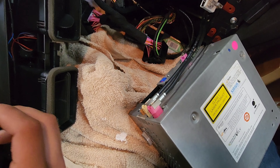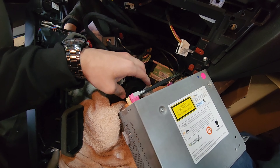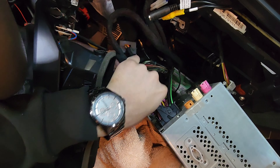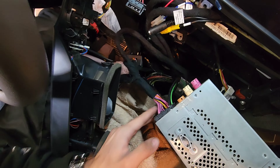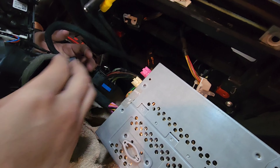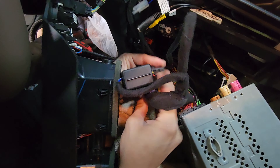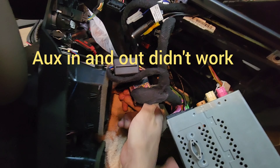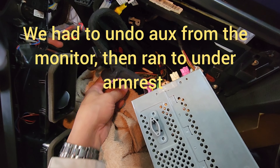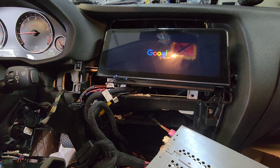You're going to put this into the back of the radio. Basically this one is a key harness — you unplug the factory one, remove the fiber optic, put it into this one that goes into the radio, and the other one plugs back into the car side. Then car information should display — just got to put the radio in place.